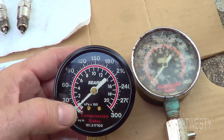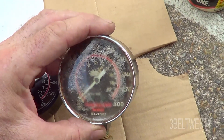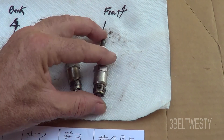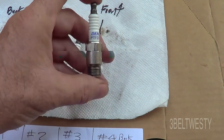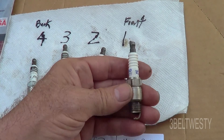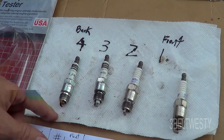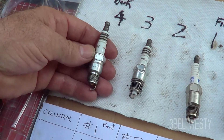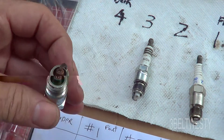Here's the old gauge showing kilopascals — this one is probably from the 70s or 80s. Originally the car had AC Delco plugs when I bought it. I put premium platinum plugs in the early 90s, Bosch, then revisited it last year and started on the old platinums. I put Denso platinums in, but the rear cylinder tended to foul out, so I got NGK iridiums. These all run fine except the rear one, which was fouling out with the brand new iridium after just 15 minutes.